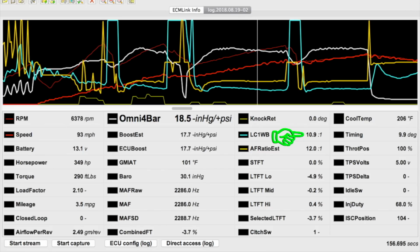This is where it's apparent that my octane rating is improving from the water methanol kit. Even though I'm missing my now incorrect target AFR value, hitting 10.8 to 11.1 AFRs with no knock on a humid summer day is still a huge accomplishment.